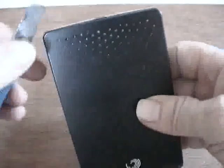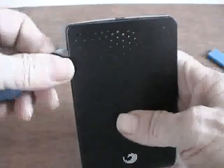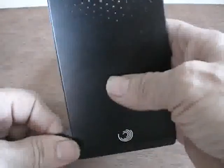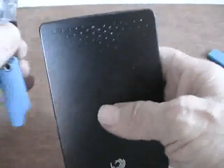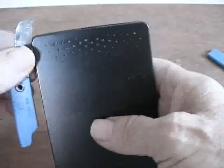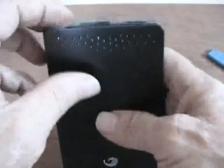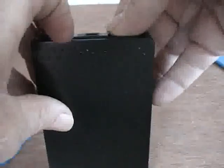All you need to do is go about three quarters of the way around and continue down until the beveled edge begins. Do not cut or pry below the point where the case is beveled. What we're doing is removing some very sticky adhesive that is holding this together — that's all there is. No snaps, no pops, nothing else. But it will not work if you try to go 90 degrees into the edge — you must have the knife angled towards you. Once you've separated all those, it's very simple to stick your fingernails in between the seam and just pop off the top.